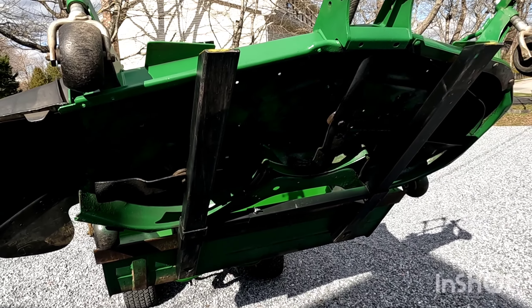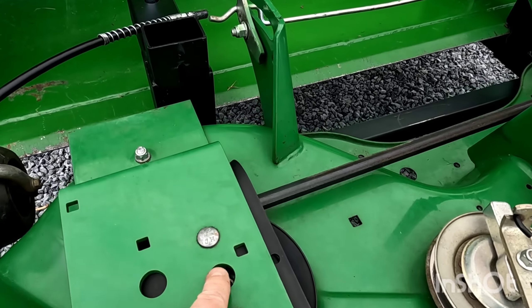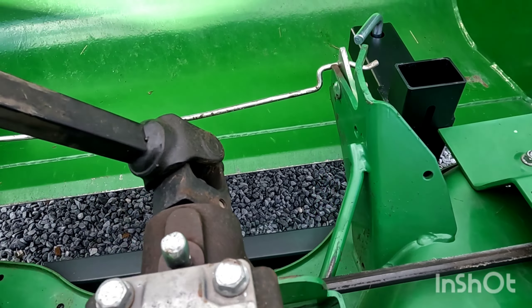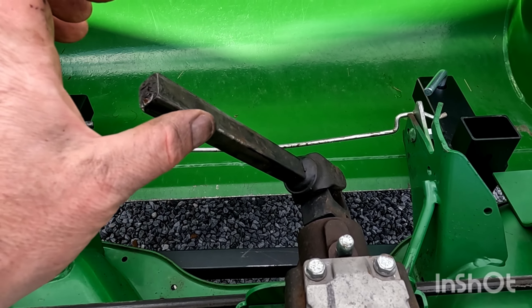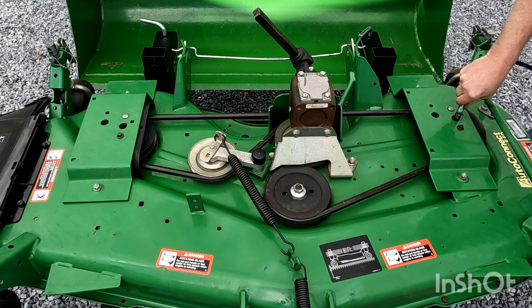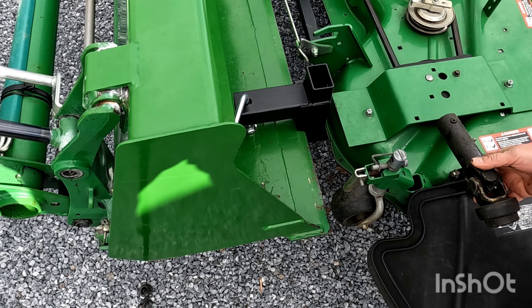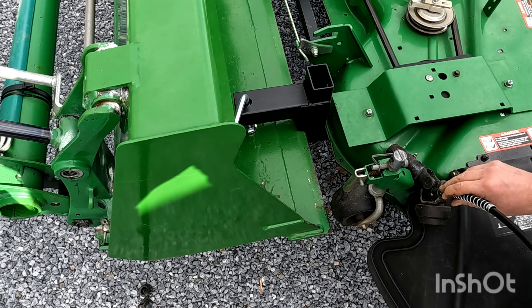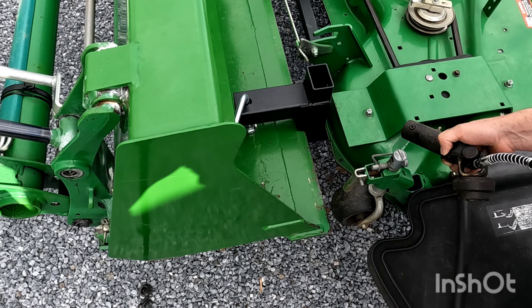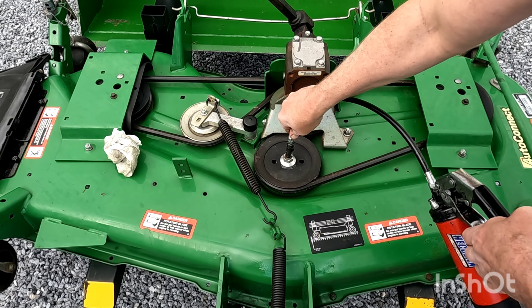You can see how handy these clamped-on pallet forks are. Next, what we're going to do is grease the spindles. There's a grease point here and here. You're going to have one on your PTO and also one on the PTO extension that goes to your tractor, and the last one right in the center in front of your gearbox.